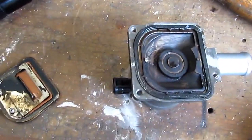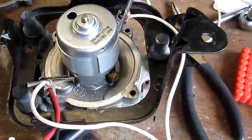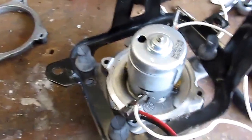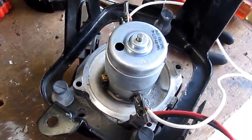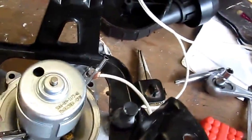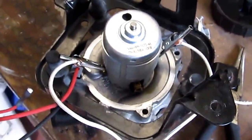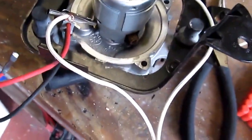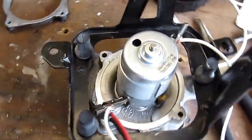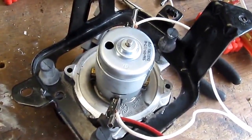This thing was supposed to be one of the root causes of the problem we were having with the truck. I was really hoping it was just the crap inside the impeller or fan blade, but apparently the motor is dead. I've got two clips going directly to the motor from a 12-volt battery underneath my bench here, so it looks like it's going to be time to order a new one.